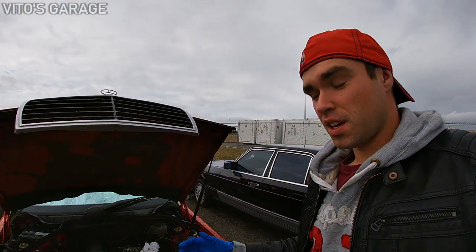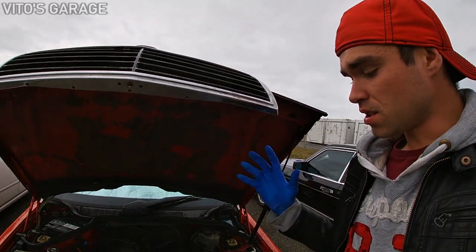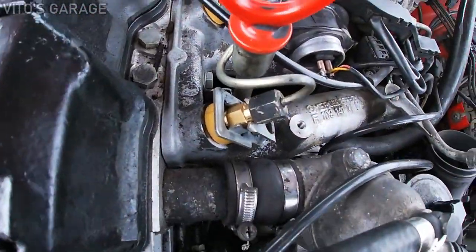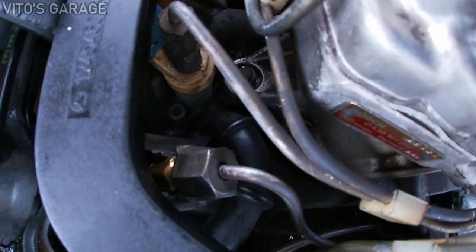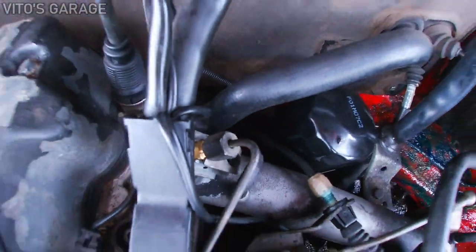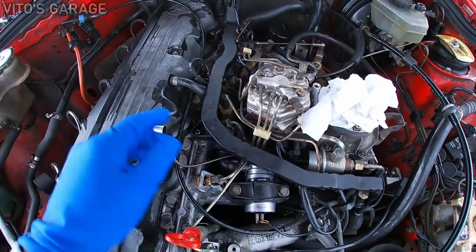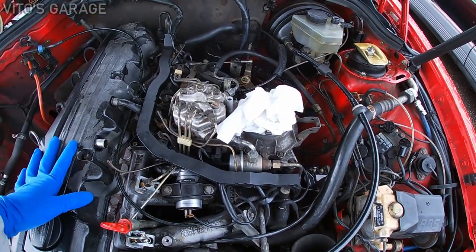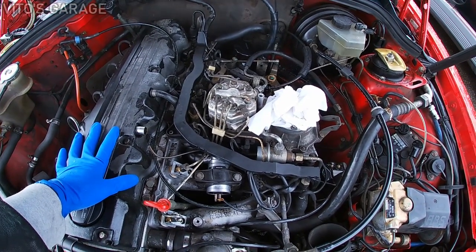This is another day — just wrapping things up. I already replaced all six injectors. Here they are — brand new fuel injectors as well as injector seals and holder o-rings. All the lines are back on and tightened up, the harness is reconnected, and I just have to put the intake back on with the air filter and we should be good to go.